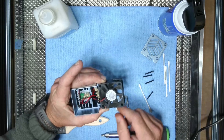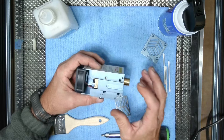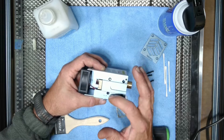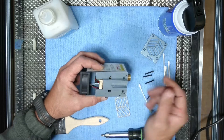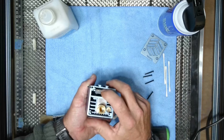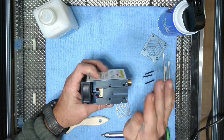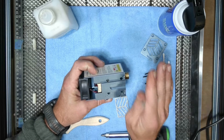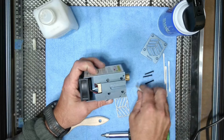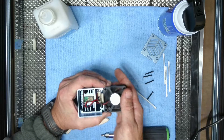There is one other thing that can be done but I do not suggest it. You have four holes here, and below these holes are two screws here and two screws here, but in between the holes and the screws is the circuit board for the module. You actually have to remove that circuit board to get to those two screws to pull that module out. If you are not familiar with doing stuff like this, do not do that. You're going to get this thing clean enough without taking that module out — you're not trying to replace the laser — so leave that just like that.